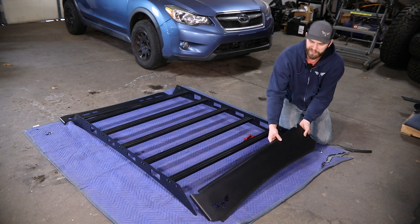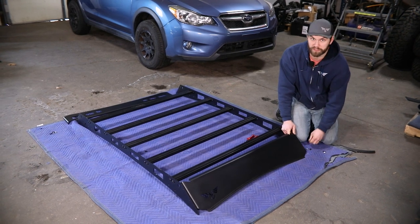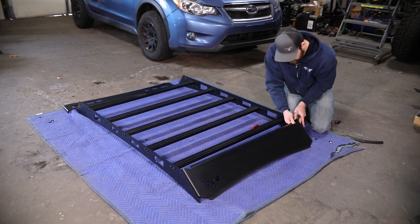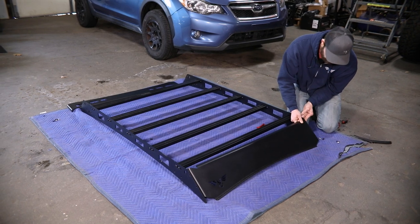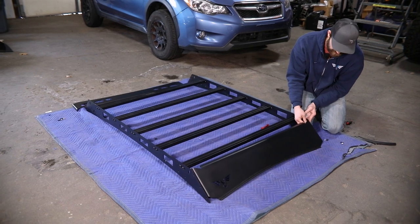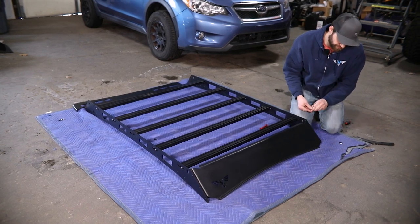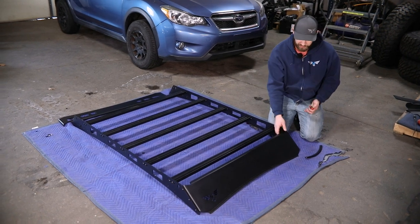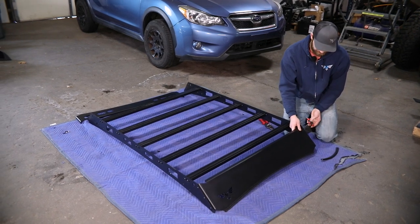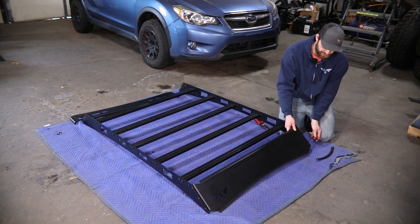To get this fairing installed to the rack, simply slide it between your two side rails and then using the same quarter-inch hardware you did on the side, push that through the outside hole as well as through the fairing. The only difference here is you're just going to be backing that up with a little serrated flange nut. Get all of those installed loosely to start with. Now that you have all those bolts loosely installed, simply slide this fairing all the way up in these slots and then snug a couple of these bolts down — that will just keep it up out of the way when you go to set it down on the roof brackets.